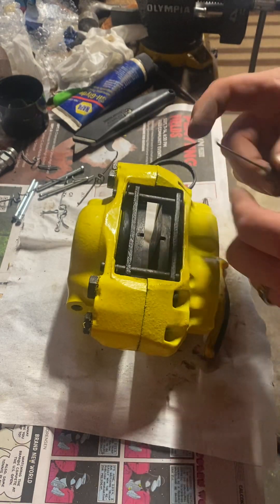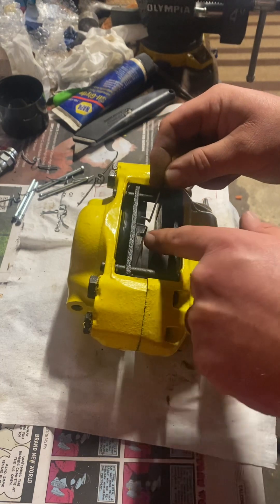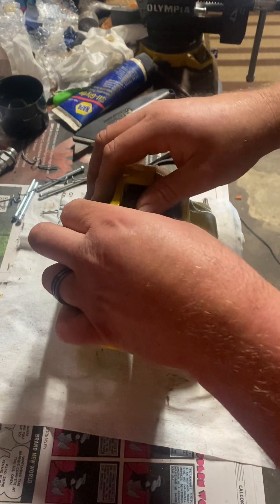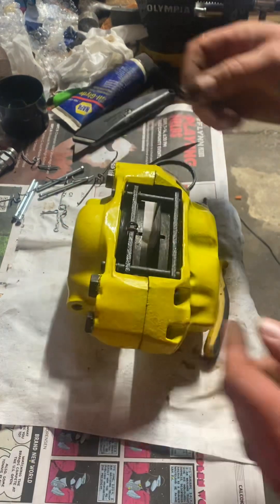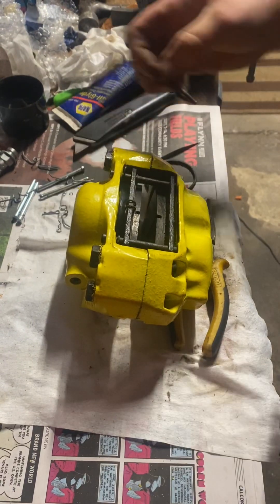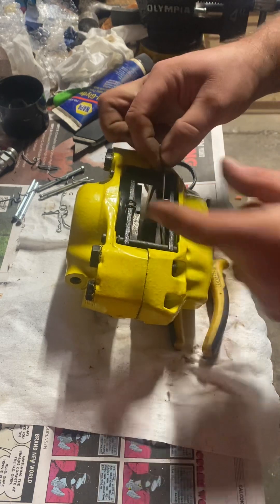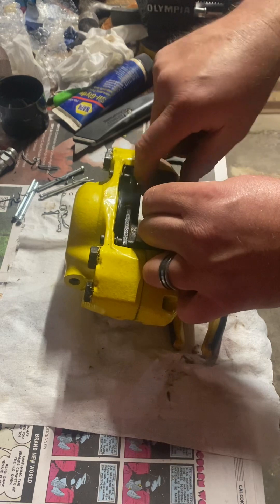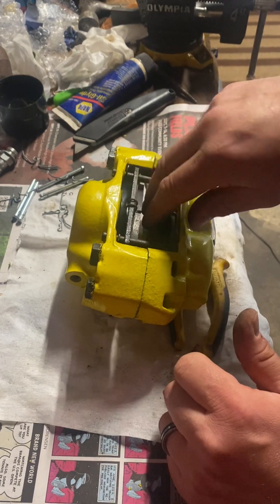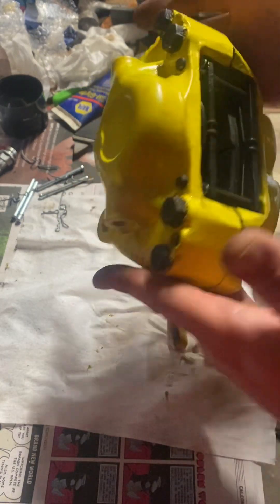So we use the old hardware even though I was hoping for new, and what this is going to do is put pressure on everything. This is going to go under each pin on the ends and then clip over there, just like so. As you can see, I'm putting in that end — it doesn't matter which end — putting in one end, bending the other underneath the pin, and just rocking it up over the edge of the pad. And there are our clips.